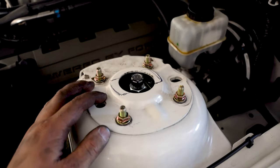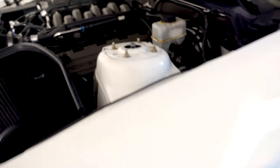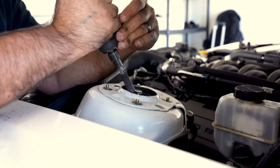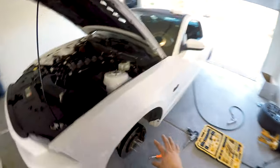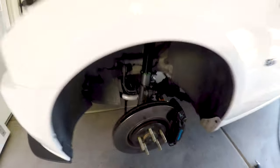You can also drill the top hat out — probably not the most ideal solution, but it is possible. What we actually did is drill out the shock towers so you can access the camber adjustment in each spot, that way I don't have to take out the whole coilover every time I'm trying to do camber. We have this one all tied in, just need to tighten up some bolts, but pretty much it's all tied in.